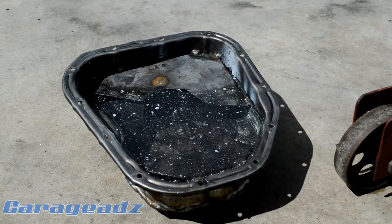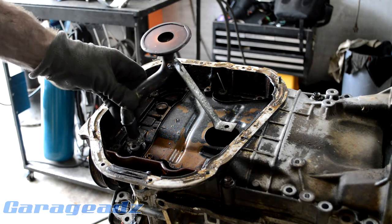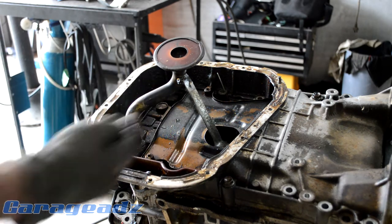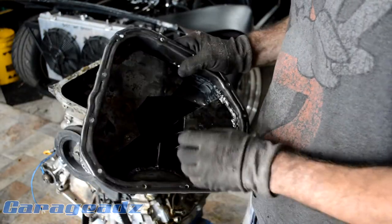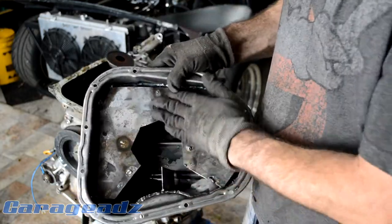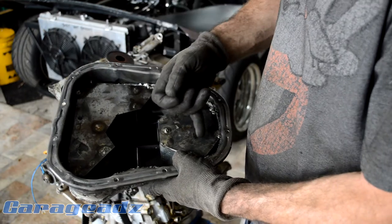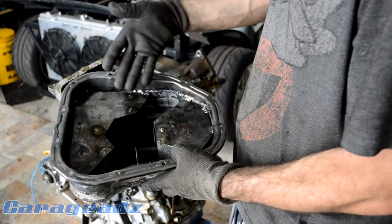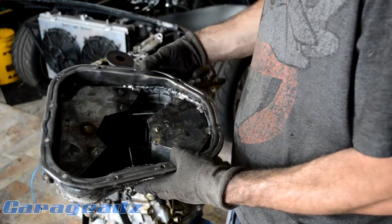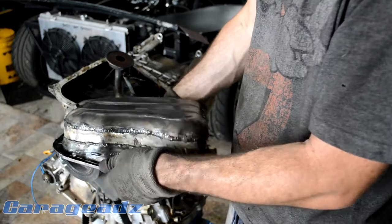Well, if nothing else, it's definitely an idea that holds water. Because I'm a lover of the double oval, I've reinstated a little reinforcement that they had. So the pickup is now in the centre and it has this little doodle to lean on. Now it's all supported and it's as good as OEM. So here's the finished product — 1.2 litres more in a prism configuration with a baffle plate. I don't give a fuck about running the edges because it's going to be in a sump. The gaps on the end are there for a reason — they let oil through. A lot of people will weld it all the way up to the top, but how the hell is your oil going to get from the edges to the bottom? You're working backwards.